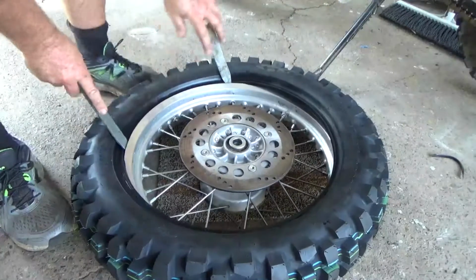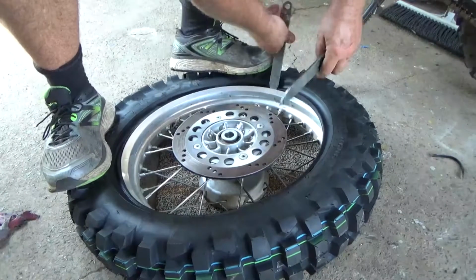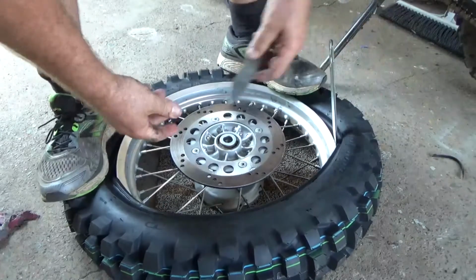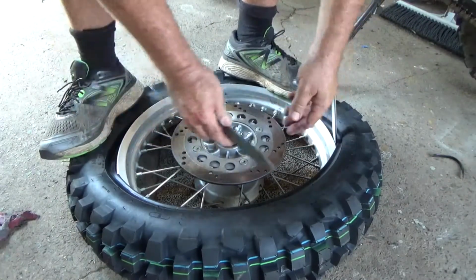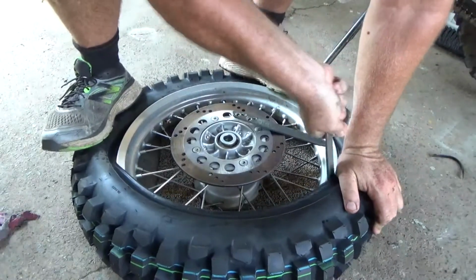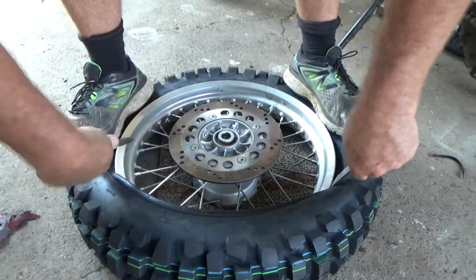Now I'm going to turn it around, put my foot on there and get that down low. Edging one side around, just work one side. Keep topping them over until it gets tight. It's starting to get a bit tight now. And that's when you've got to make sure you got the back end down in here. Now just start taking little smaller bites, just to ease it around.